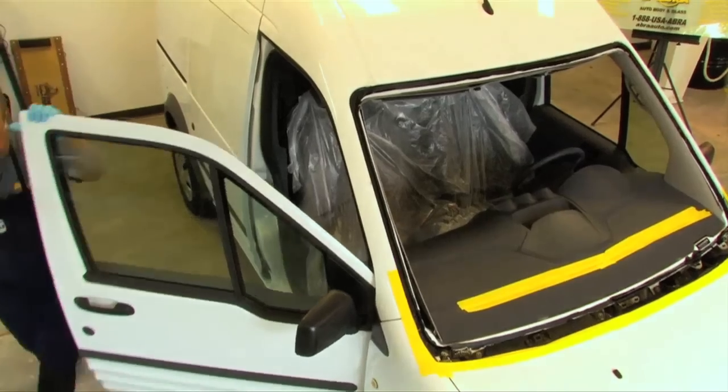The working time of this product is roughly about six minutes at today's temperature. If you wait more than six minutes, the product will actually skin over and will not adhere to the windshield, so we need to hit the proper timing. This is why we spent time prepping the windshield and having everything ready to go — so when he's done applying, he paddles the seams and sets the windshield.